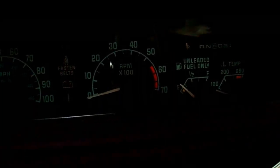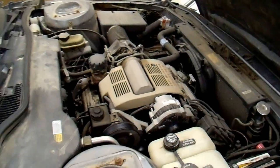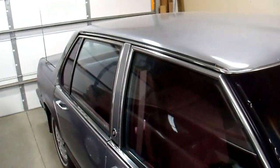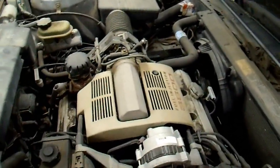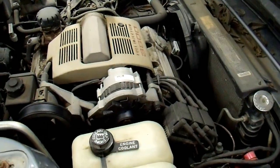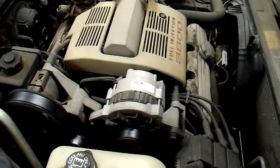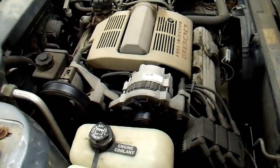So I replaced it, but these symptoms are starting to come back. It still runs fine, but I'd like to repair it to make it more reliable for the wintertime. If you ever have one of these old 3800 vehicles — and the 3800 is one of the most produced engines in world history, put in so many different vehicles — this applies to a lot of people. If you ever have trouble with these engines abruptly stalling, check the crankshaft position sensor. I'm going to show you how I'm going to fix this thing up in just a few minutes.